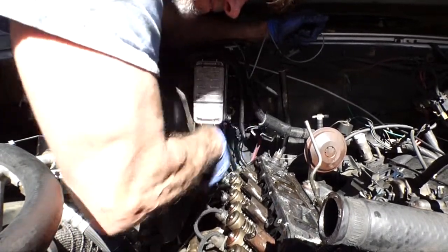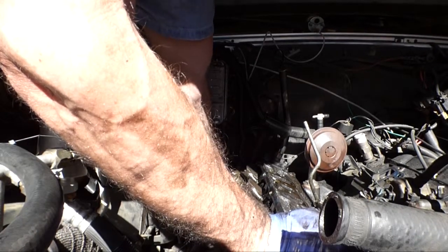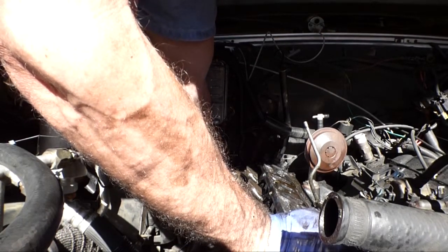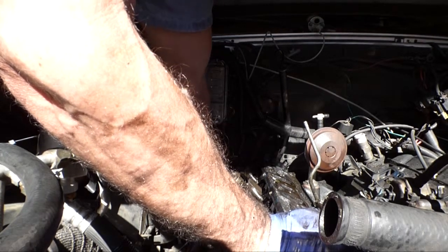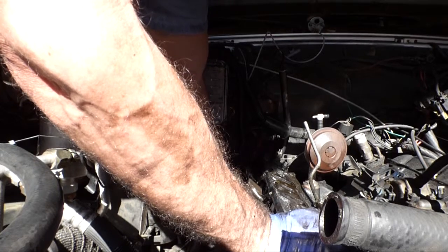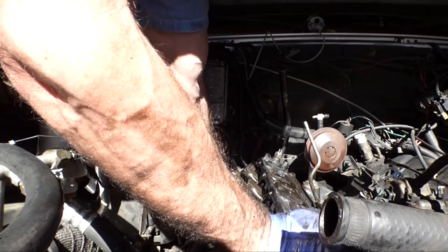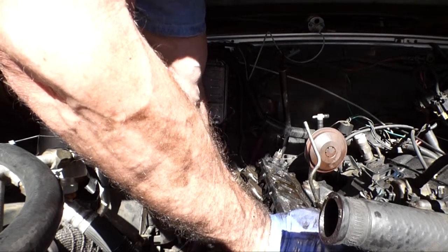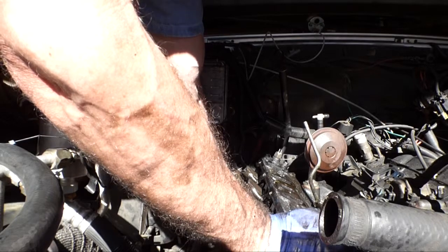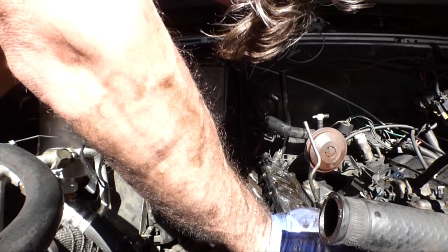But I'm fixing up all this head. Got a nice puddle of water with a tinge of antifreeze all over my garage floor now. I recommend when you do this, pull a lower bolt first so you can drain all the water. Maybe you can keep the water out of your oil. Because I'll have to definitely change the oil after this one. Definitely.